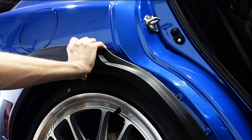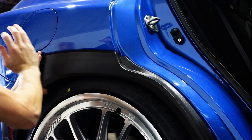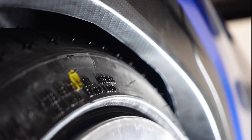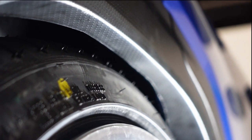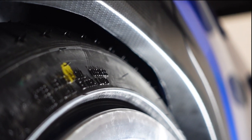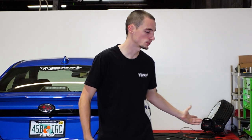You put this back on. You can see where this comes up — that's about where it starts to curve in. You can actually see right about there is where we started to cut and brought it down and feathered it out. As soon as there's weight on the rear of the car or the rear hits a bump, it actually just pushes up with just enough camber and it clears. We have yet to rub in the rear with this setup, so it's pretty cool. That's all I have for you guys — just want to give you a little information on these wheels and how we have them set up. Let's go ahead and get into some shots.